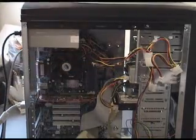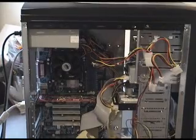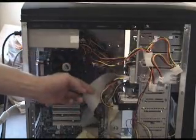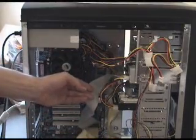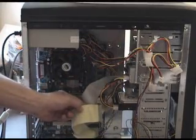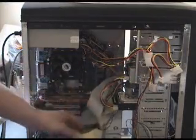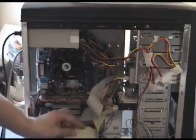Now, don't worry about using an older 40 strand cable for this CD. This 40 strand cable won't really reduce the throughput, and it'll work alright for burning and for reading. But if you do ever add another hard drive onto this IDE channel with the CD-ROM, then this cable will slow down the hard drive, because all the hard drives you buy now require one of these faster 80 strand cables. So if you ever put a hard drive on this bus with the CD-ROM, change this grey cable for one of these. They're about £5 or £6 from a computer fair.